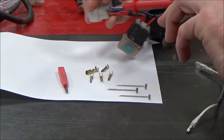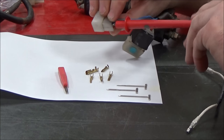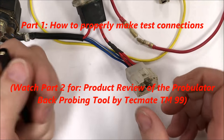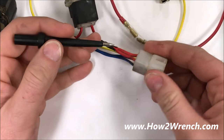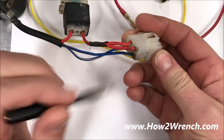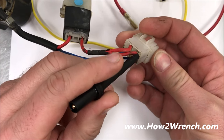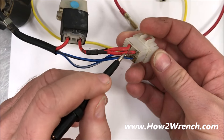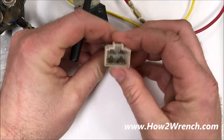In this video I'm going to show you some great practices for back probing electrical connectors when doing some testing. What we're trying to do is not violate the connector, so follow these tips for good practices. Let's take a look at how we can test these connections without violating or damaging their integrity. It's a lot better idea to back probe or come in on connectors where there's quite a bit of space — just be careful with a sharp probe that you're not piercing the wire.